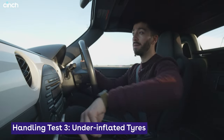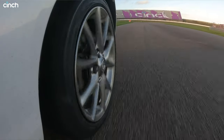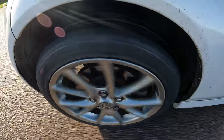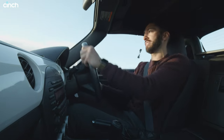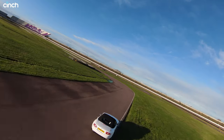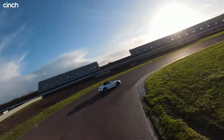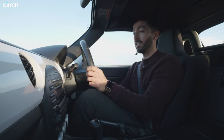What about the under-inflated tyre? Back in the white MX-5 with pressures at a very squidgy 20 PSI — I can see the tyre wall looks thinner on the ground. In turn one: good grip, actually a lot of grip. It feels not dissimilar to when the tyres were correctly inflated, which is interesting. But over the water — big breakaway. On the dry the grip is good; on the wet it breaks away quickly. This last hairpin is damp — it does a power slide but there's definitely a lot more grip than there was with the over-inflated tyre.